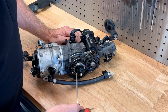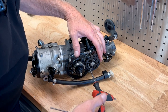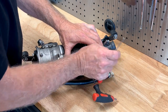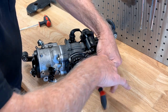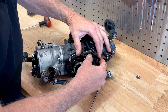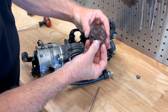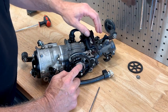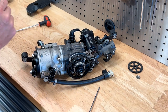To get this main gear off we need to remove the idler gear first. Simple process — we'll get another allen key and stick it in to stop the gears from rotating. That lets me get in there and undo the allen key. Once that's undone, get that out of the way. The gear is on a little square — you can see it there — just a little wriggle and it comes out. That gives you access to your main gear assembly.